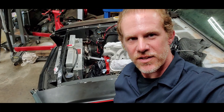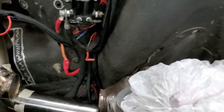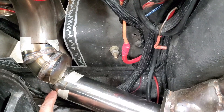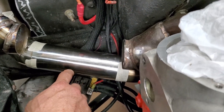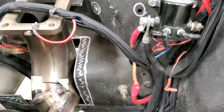I started making some pie cuts, started test fitting the turns and everything going to the headers — let me get you guys a closer look. You can see I've got both turns there — this one's welded, the other one's just taped. This straight piece of pipe is going to come out; the only reason it's in there is to help make sure I got it lined up from the header to the turn into the flange itself. I'll be removing that piece of straight pipe — I decided to solid mount the turbo to the apron and the frame rail.